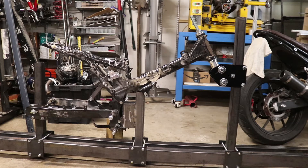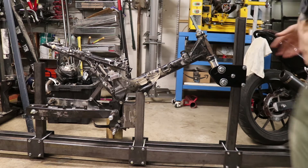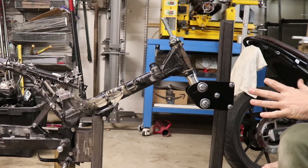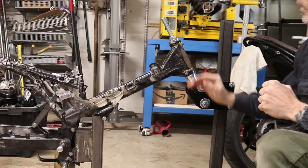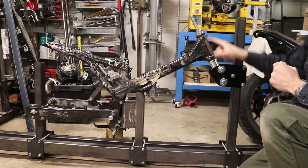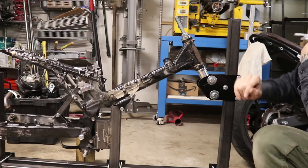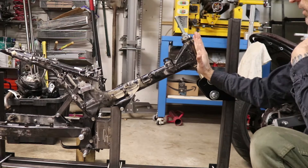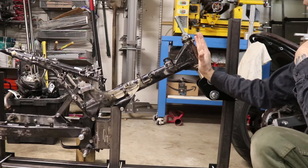Here's a motorcycle frame in a frame jig. What we're trying to do is make a new frame with very similar proportions to this one, because this frame can't legally be used. We're going to make a whole new one, and we see this as an opportunity to do something interesting — part of that is changing the rake up here. This angle here is called the rake, and we think we want to change it so it's tilted in a little bit more.